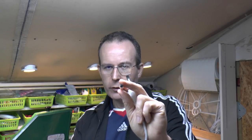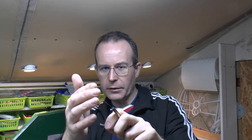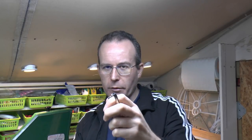So that's inside a fairly typical heating element — pretty standard, with the prong on the end and then the tube with the magnesium oxide and the heating element inside. It's coiled up to obviously give it a much greater length so you can have the appropriate resistance that you want. Generally, if these things are higher power, all that's happened is the actual length of wire is longer, so you can obviously get a larger surface area for heating. And obviously the length and gauge of the wire also vary depending on the actual power rating required.